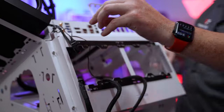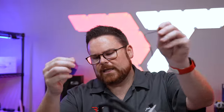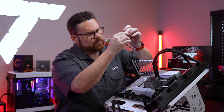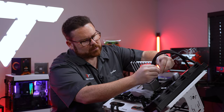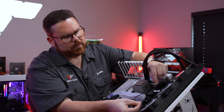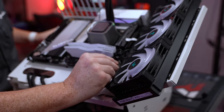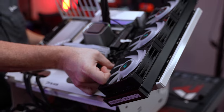Now that's all connected, you have one more cable from the pump header — run it up and plug it directly into your fans, daisy chaining with the rest. And there you go — you now have a completely set up Deepcool LS720.